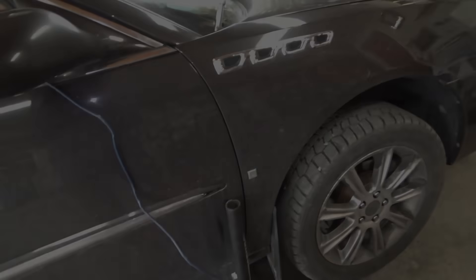I spoke to the customer about the Buick LaCrosse. We fixed the parasitic drain, fixed the ABS problem — no parts required. The alternator he'll take care of himself. The OEM unit is ridiculously expensive at around $400, so he's going to try to find a genuine regulator to put in the previous alternator, which is stamped ACDelco. Those eBay or Amazon units just don't work very well. Pretty neat case study — thanks for watching, see you on the next one.